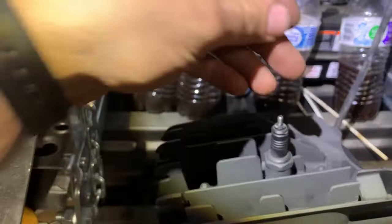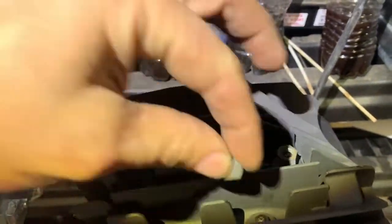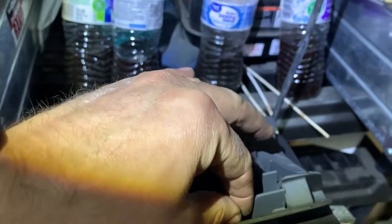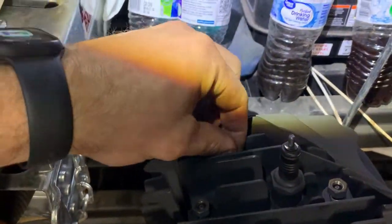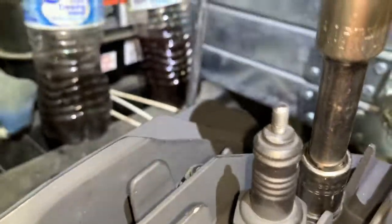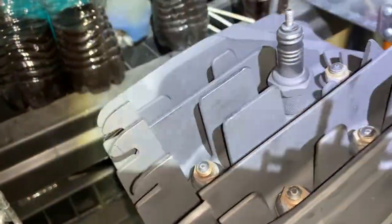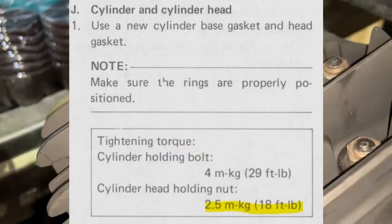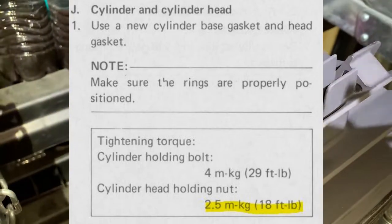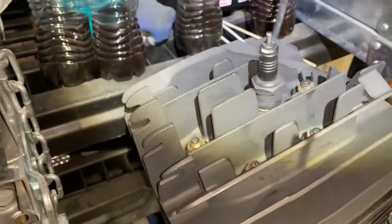The thing is, I don't like these nuts, so I'm probably just going to replace them. They just look so ugly — maybe once I get everything torqued down, if I blast some paint in there it'll probably be all right. So there's all six torqued to 220 inch-pounds — 18 foot-pounds. The exact number is 216 inch-pounds but I just rounded to 220. Good enough. Now let's actually try out our dial gauge and see how things worked out.